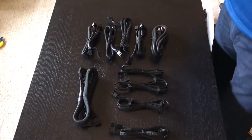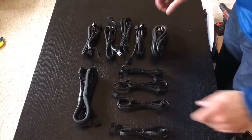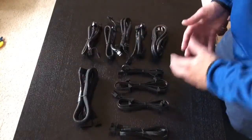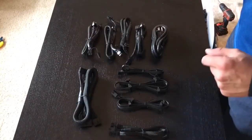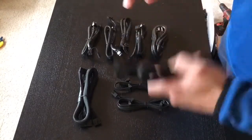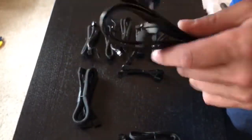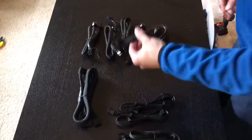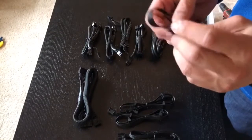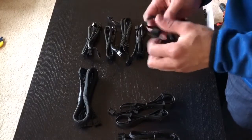So if you're like me and you've never built a computer in your life, you're going to need a walkthrough of these cords and what they are. You're going to get a bag full of cords, and these are the ones you'll need out of that bag. You're going to need one CPU power cable, two SATA power cables, and then this very important cord that's going to add extra power to your motherboard, because these are high-power rigs that draw a lot of power.